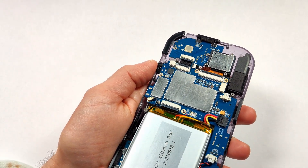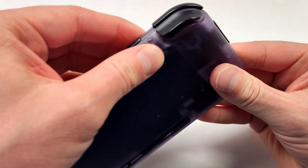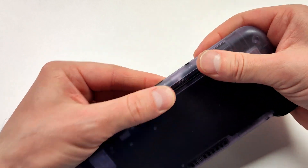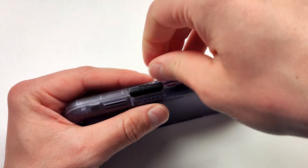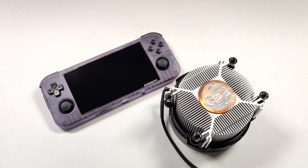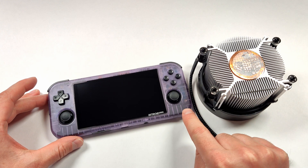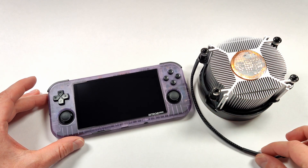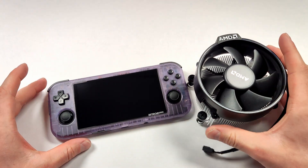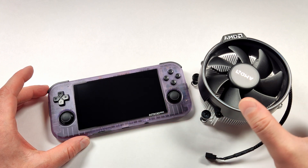I've been really careful with how I've done this, and I don't recommend anyone try this to their units. I just wanted to see how this would work, and I didn't want to make any hard adjustments like cutting the shell. At full load, the Retroid Pocket 3 Plus does a pretty good job at keeping temperatures below 85 Celsius. Moving forward, I hope to see more active cooling on handhelds in the future. Looking at the size of this heat sink right beside the unit, you can see it's absolutely massive compared to the handheld. Putting a cooling solution of this size into a handheld is obviously not practical, but having a bigger heat sink seemed to help way more than just a fan.